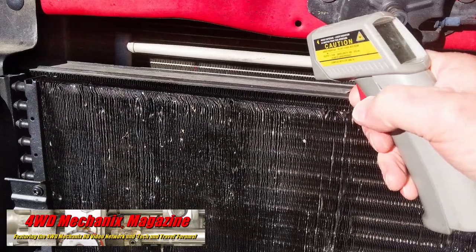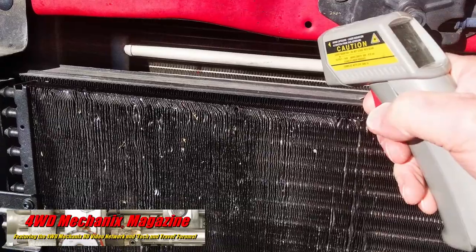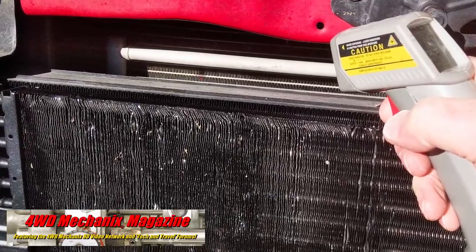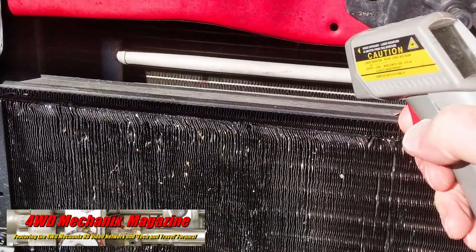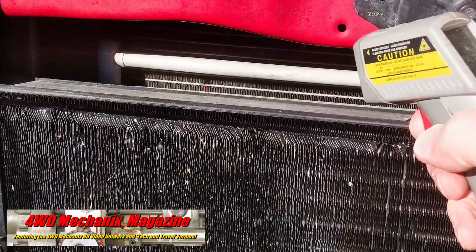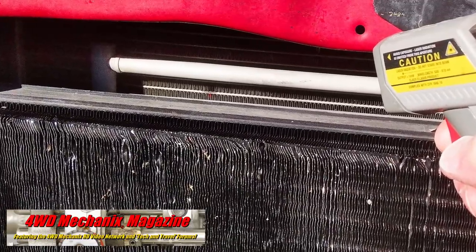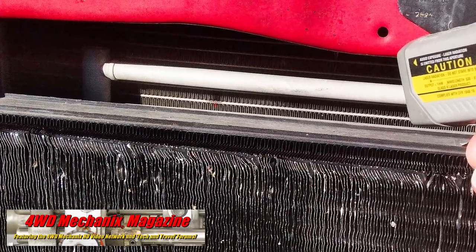With the engine running at operating temperature and the coolant circulating, use an infrared non-contact thermometer to check for uniform temperatures across the radiator core. A distinctly cooler section in the radiator core indicates a radiator tube blockage. Compare temperatures at the end tanks of the radiator. Check across the core where accessible and safe. Stay well away from the engine cooling fan.